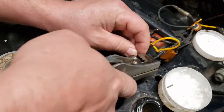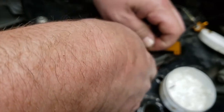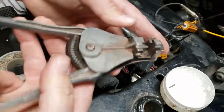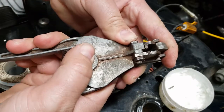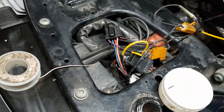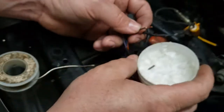There's a 05 DynaGlide. You'll have to check there for yourself. Not a lot of wire to work with here, but in case you're wondering how these cool strippers work — as they close down, they pinch the wire here, then it grabs it back here with a little gripper, then you squeeze some more and it strips them off. These things are like 50 years old and they still work amazing. I'm not joking about the age either — they belonged to my grandfather.